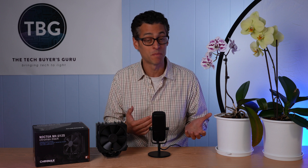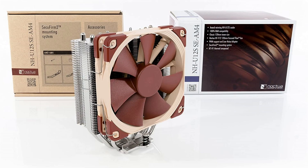So this video covers both of those coolers regardless of color. There is one caveat though: if you purchased or received a U12S second-hand that was manufactured before 2018 or so, it won't have the AM4 bracket in the box. That's because AM4 didn't exist before 2017 and the cooler was released in 2013, but also because initially Noctua released a special version of the U12S called the AM4 Special Edition, or SE. That one was what you had to buy if you wanted to mount it on an AM4 motherboard. Noctua, like a lot of other cooler manufacturers, didn't know how successful AM4 would be, so they released a special SKU rather than repackaging their existing SKUs.